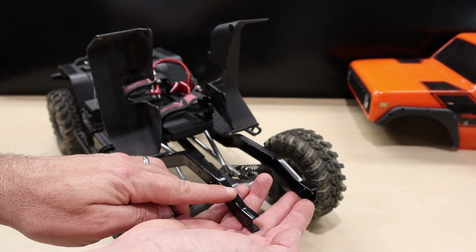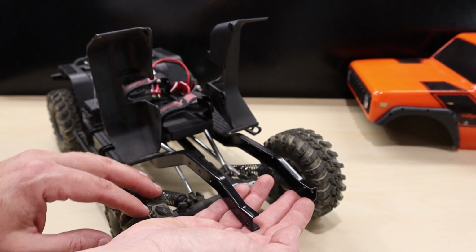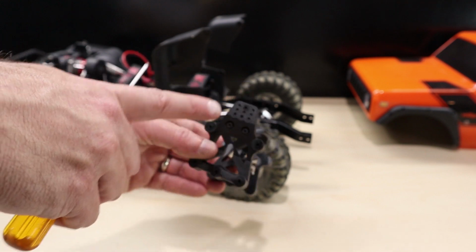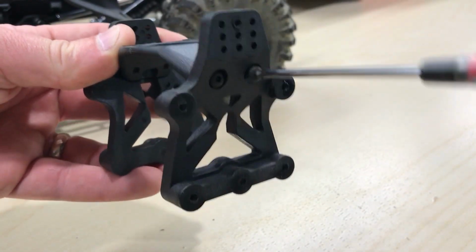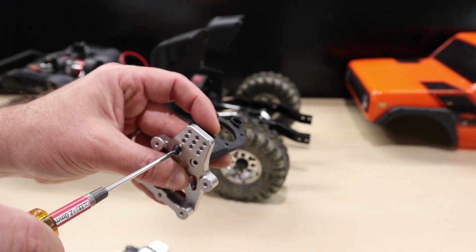Removing the rear bumper isn't completely necessary, but it gives you the freedom of moving around while you're taking things apart. Next, we have to transfer the cross brace to the new shock towers. Do so by removing the 4 screws that secure it. Now we could reinstall the bracket onto the new aluminum shock towers using the stock hardware.